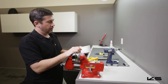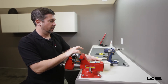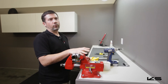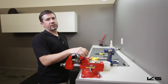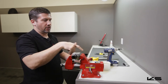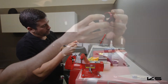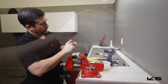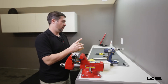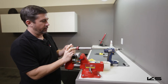What we're going to use is some KS Post Paste. You can get that through your local bike shops anywhere you buy KS products. If you can't find it, you can use Slick Honey, which is also available at most bike shops. Try to avoid using Teflon-based greases or lithium greases — they gum up really bad, don't offer much water resistance, and generally don't work well with suspension. This grease was designed to work with suspension and sliding bushing systems. Go ahead and fill the little cavity between the two wiper seals. We do that to make sure it properly lubes the stanchion before it goes through the bushing, and it creates a water seal so water doesn't get inside the post.